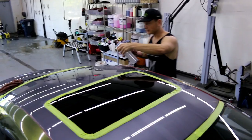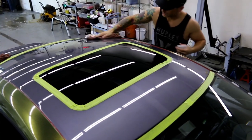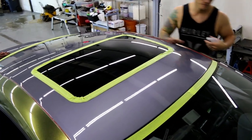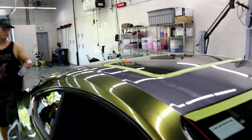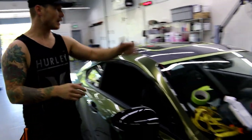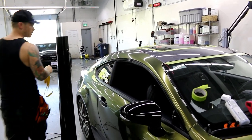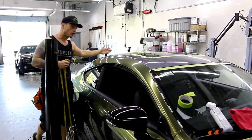This is a roof — I can already see imperfections in the paint itself. It's not going to be flawless on pretty much any car. You go through a little hailstorm or anything like that, and there's a very good chance there's going to be very minor imperfections which might show through slightly. All the stages of prep have been done. What we need to do now is cut out or measure the area of this roof. Typically, roofs are a little bit longer than 60 inches, and only about 48 inches wide.